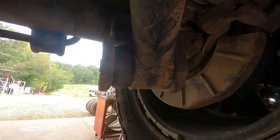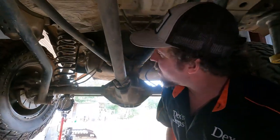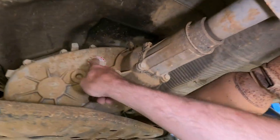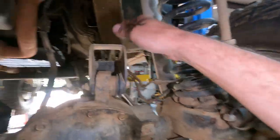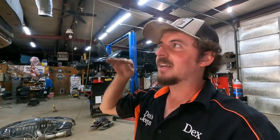This looks like a can of biscuits when you bust it open — that's got to be fixed. The vent tube situation — we don't really participate in that. It's crazy seeing people do so much of the right thing and then avoid the simplest stuff. This thing's probably gonna need all the bushings. It does have the 247 HD transfer case. Always tighten your jam nuts — I've seen those come loose on a four-link and they'll fall apart. So close to getting this motor out — I know it's gonna be bad inside.